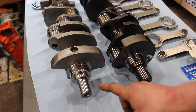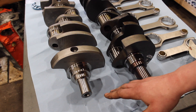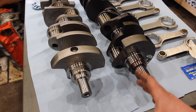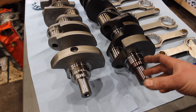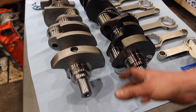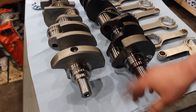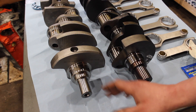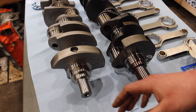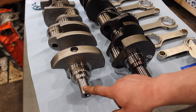We ended up cracking two balancers and actually damaging the nose of the crank. No one could really give me a reason why this happened. I thought maybe I over-tightened the blower belt — something I've dealt with before — but I've never had an issue with blower belt tightness. Checked everything. On the first one I thought it was something I did wrong; the second one I just wasn't sure, and I couldn't get a real answer. The blower seemed fine because it was brand new, and the belt tension was fine, but we kept cracking the balancers. We were using good ATI balancers.